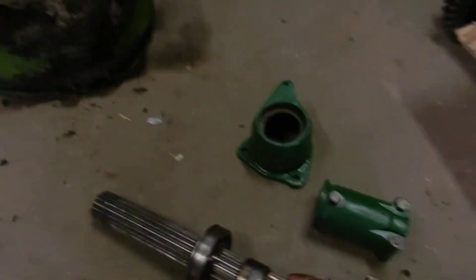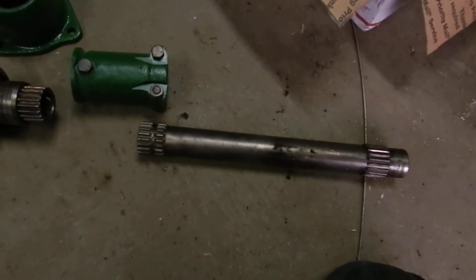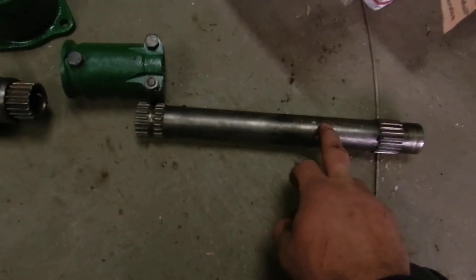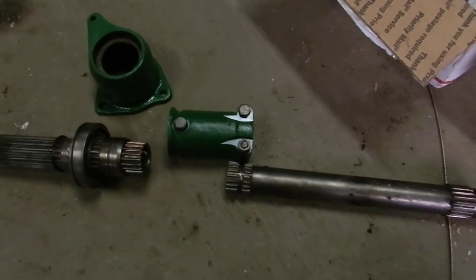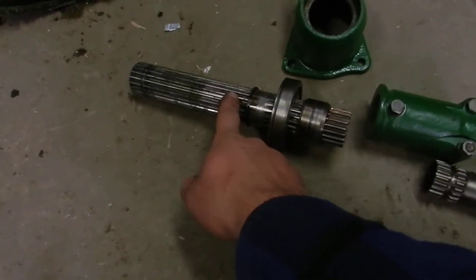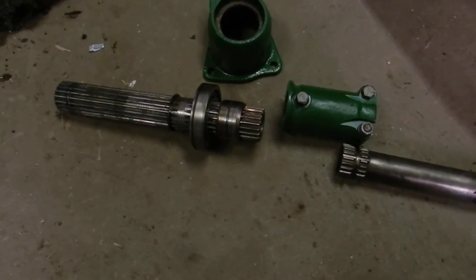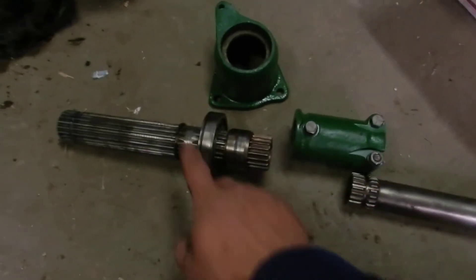Here are the pieces you need to replace this. You'll need a new transmission input shaft, a belt pulley delete holder or a belt pulley, a coupler, and a new clutch shaft. The interesting part is this clutch shaft is particular to a 770 only — that's the tough piece to find. I also have an 880 with a power booster that needs to be deleted, and what I'm having a hard time finding is the shaft, because on my 880 it's a newer version with a helical gear transmission, so the input shaft is particular to that tractor.